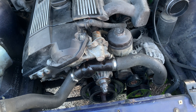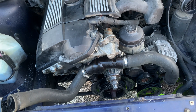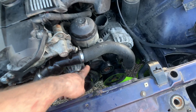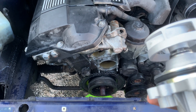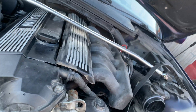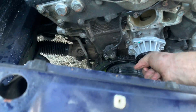When I remove the water pump - which was a long story, how long it took me to get the fan off; I had to use an angle grinder in the end, it was properly seized on - pump the water through, make sure it's running out clear and nice, and then you can remove the housing for the thermostat and the water pump. The new metal-impeller water pump goes in - aluminium should last better than the one that blew up on me about six months ago. Moisten the O-ring, it'll only go on one way. There we go.